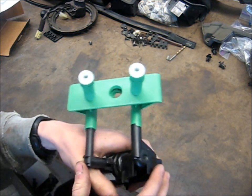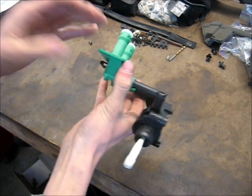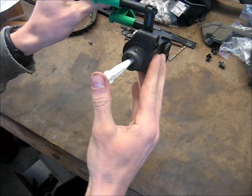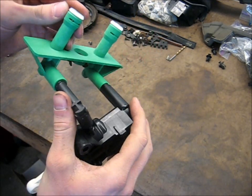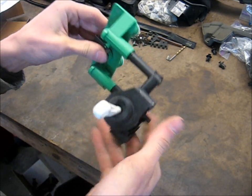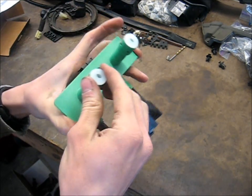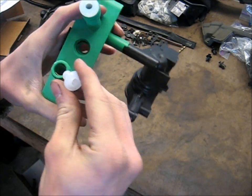Here's the new one. Basically, I think it's mounted like this inside the car — firewall being here, your pedal being somewhere around here, and it presses this push rod in and out. So inside the car, you get to disconnect it from the pedal assembly and from the firewall, either from the top or from the bottom. You have to disconnect the lines. So that'll be fun.